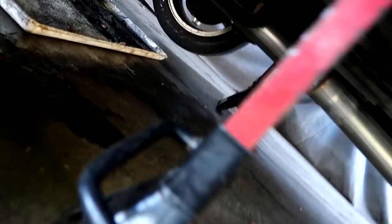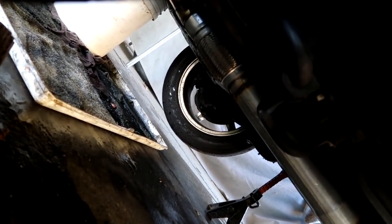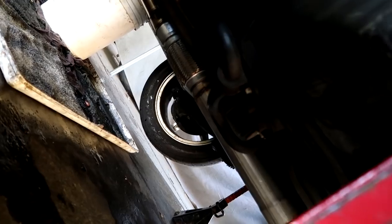So before I take off the downpipe, I'm gonna go underneath here and cut the exhaust because the muffler shop that he took it to didn't have a flange. So it is 2.5 right there up in the front, and then it goes to 3 after the flex all the way back, full 3-inch. The whole exhaust system has to be redone later once the driveshaft gets put into place, but for now, I'm gonna put a flange up there in the front.